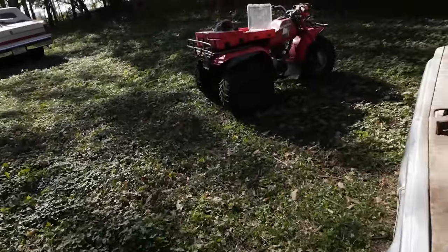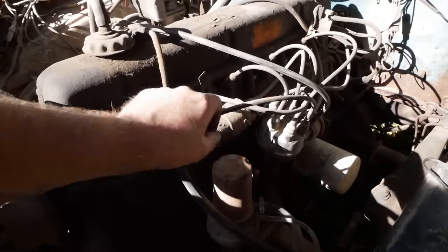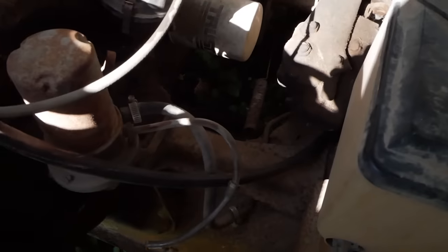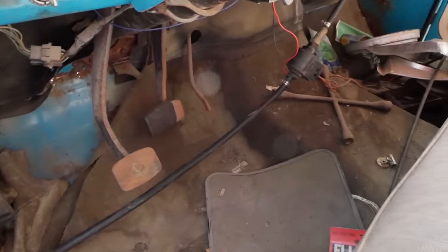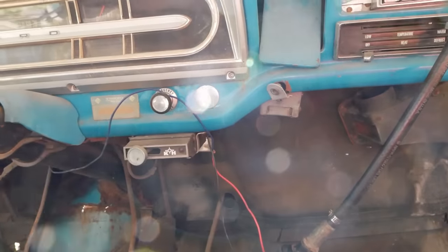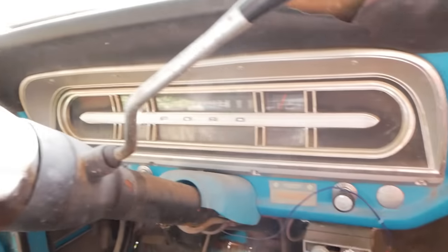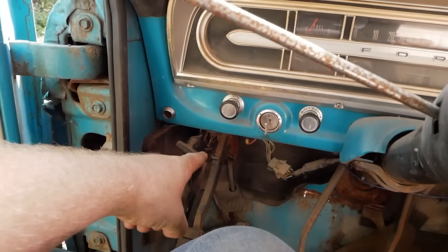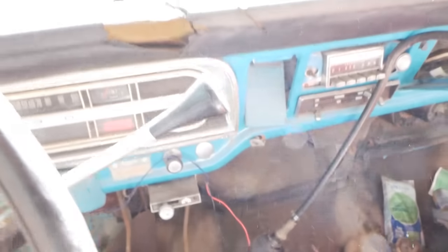Okay, as another train goes by, we have set up our fuel system. We now have a line that runs into the carb, hooked up to our soft line, which runs through the rust holes in the cab, into the cab, up through the floor, across all where my feet are supposed to go, and then into our boat tank. Got it grounded out to some bolt that was on the trailer brake controller. Ooh, which works! Sweet! And then the positive is just shoved into a fuse over here that activates off the key. So as you can see, we've got fuel moving.